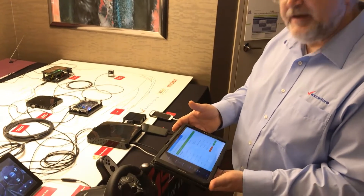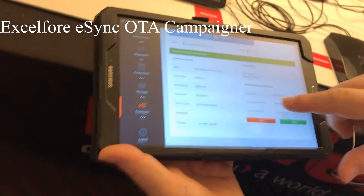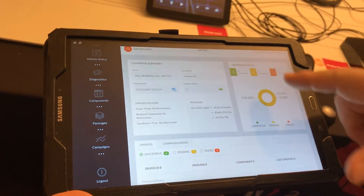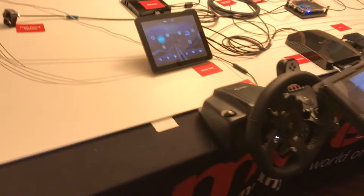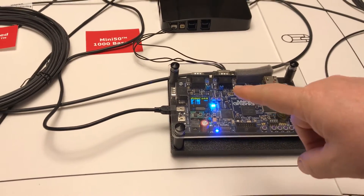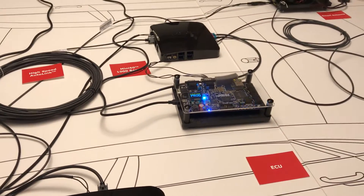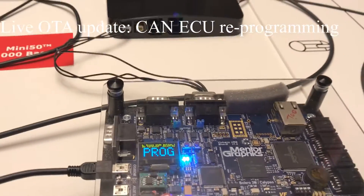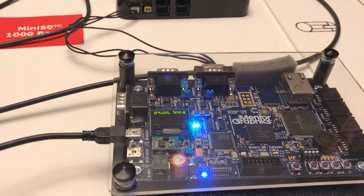So I've got my campaign for the over-the-air update all created. This gives me a summary review of the campaign, and now I'm ready to deploy my campaign to upgrade my system. The campaign is now pending and it's in the process of updating. As the system upgrades, we'll be able to see on the diagnostic screen an indication that the ECU is being reprogrammed. There we have it — it's now begun, and it is reprogramming. We're getting a new flash to this AUTOSAR ECU on the CAN bus. That is now complete.